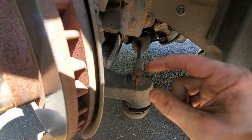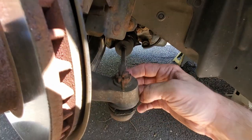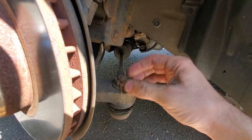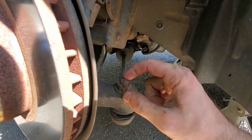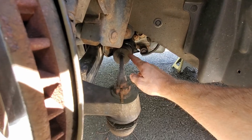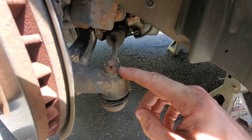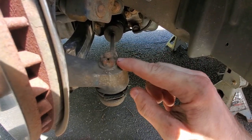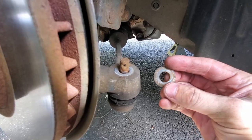What we're going to want to do is take these retaining cotter pins out and loosen up this nut. If we don't loosen up the nut while this is still tight, it's going to be extremely hard because the knuckle is going to move when we try to loosen it. So I'm going to take this cotter pin out, and then we'll get into the next step. Now that we have the cotter pin out, all we're going to do is grab a 19-millimeter socket, get it on here, and break this loose.